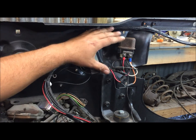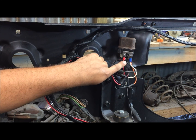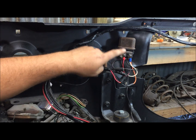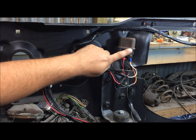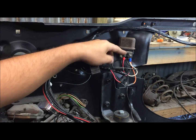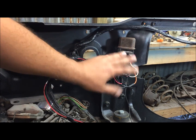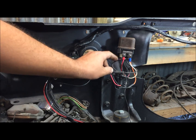One going to the horn relay — that's acting as another junction block — and the other one going to the external regulator that we cut out. Now the other junction block comes over here and this also acts as another junction block. So anything that's run off of this will need to be fused because this is unfused from the battery.